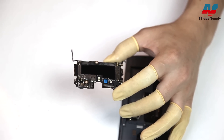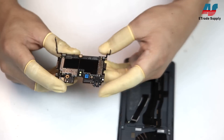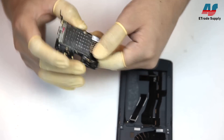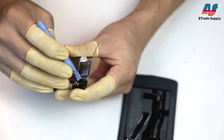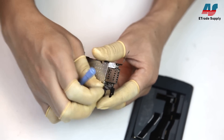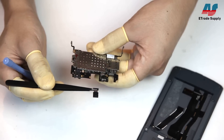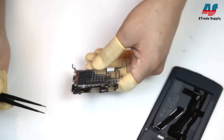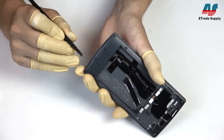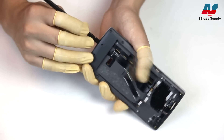The main board is compact and really tightly built, and there isn't too much to remove from it. We can remove the front facing camera though, and we'll use our spudger to do that. Then with our case opening tool, we can remove the cover over the charging port assembly.